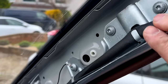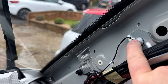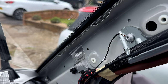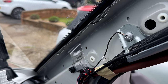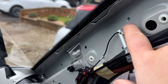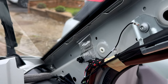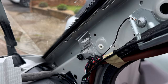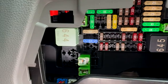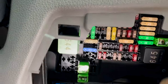All cable tied in nicely, all the way down. And luck would have it — there's a bolt there that looks like a great grounding point, straight into the bay pillar. It sounds like plastic but it goes straight into the bay pillar. I checked and made sure we got a good ground there — looks really good. Just putting this all back together now and I'm really pleased — much better than what we had before. I can confirm that is a really good ground point.